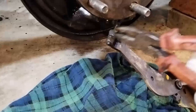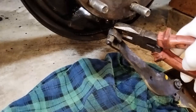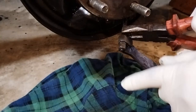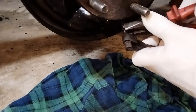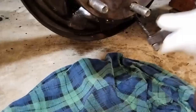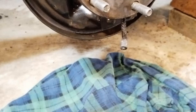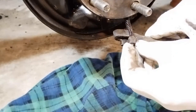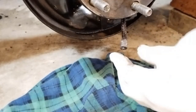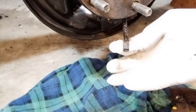To remove the cable from the arm that's connected to the shoe, you have to pull this spring back. This tab has to come forward and it'll come out. When this is connected, you just grab onto that, pull this forward and this back and it'll come off. It's just really creating a gap between the spring and this grommet here.